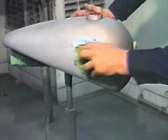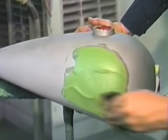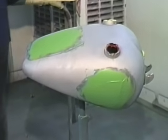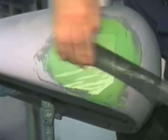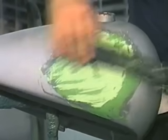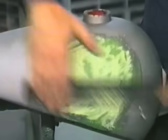Add it carefully to the side of the tank. Remember, whichever direction you're pulling from is the direction the plastic filler goes — pull back once in a while in different directions to get it centered over the damaged area. Now we've put it in the areas that we need. When the plastic filler gets to a half-hard stage, we go and get our half-round shredder and use a random pattern when we shred — just like we do when we sand. This is a form of blocking.